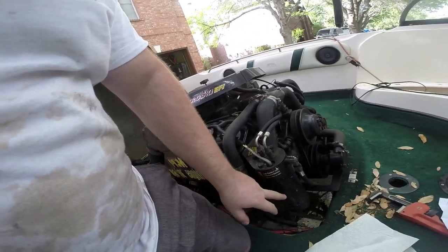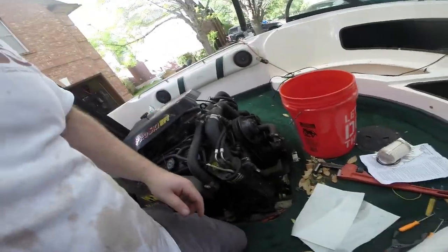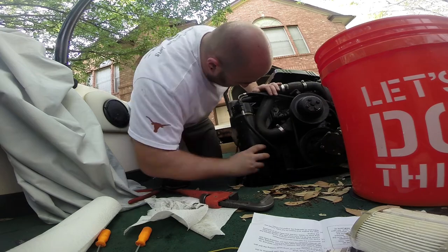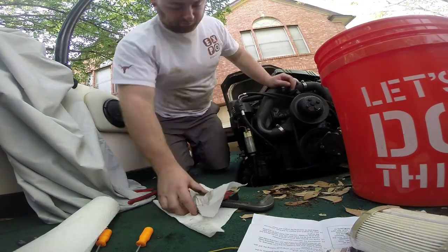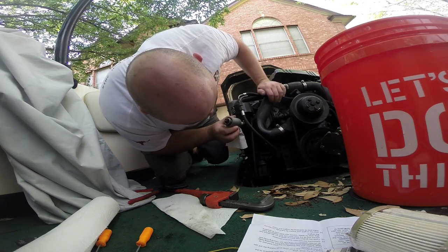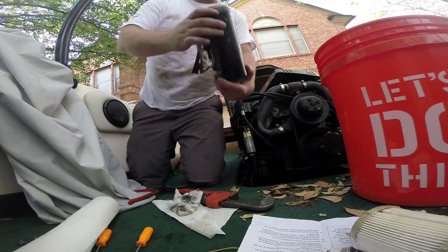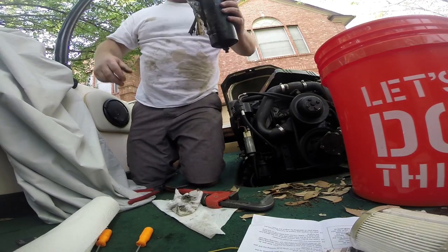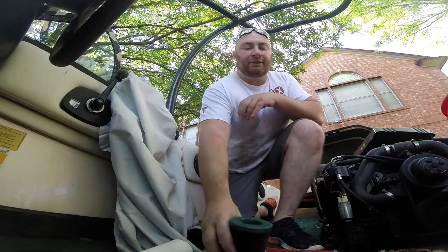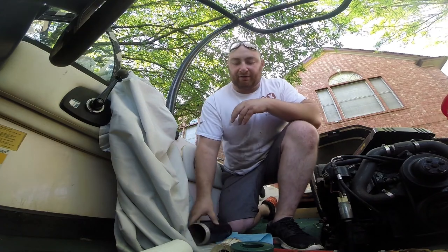Basically it's this canister right here, and you're going to need a big wrench to disconnect it — it's going to be full of gas and water, so you need a bucket and paper towels. There's our high-pressure fuel pump; looks to be in pretty good shape, actually. Nice and clean. The old filter is actually not as bad as I thought it was going to be. It took quite a bit of hammering to get it out — it's a very snug fit — but the O-ring up here has disintegrated completely. Thankfully, we have a new one in the kit.